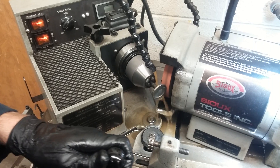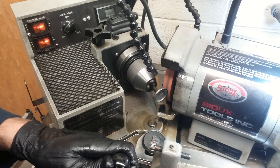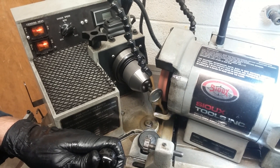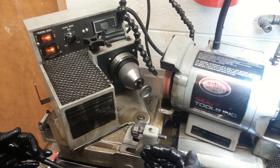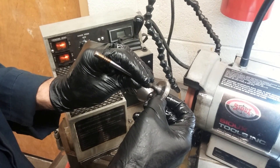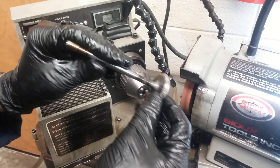I move this back and forth as I turn it in a little bit more. Now you can hear the sound is a lot more constant and steady. Maybe one more time I'll adjust it in and move that back and forth. I'm feeling satisfied that it's ground a smooth surface, so I'm going to back it off. Don't pull it off — back the valve away and then slide it over. We'll pull it out and take a look: as long as it's got a shiny new surface all the way around on that face, it's good and we're done.